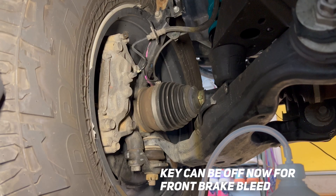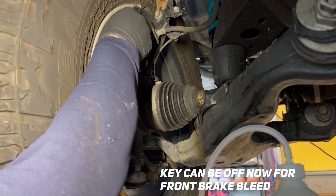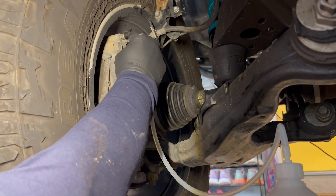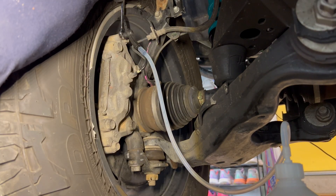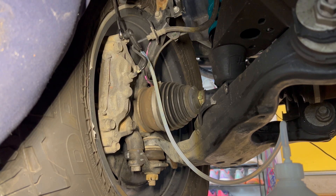Make sure that brake fluid is topped off. For the fronts on this truck with this hydraulic master, it is a standard brake bleed. Let's go ahead and climb under the front, pull off your dust boot cap, get your nipple hooked up to the brake bleeder, and once that is secure we will go ahead and crack open our bleeder screw.